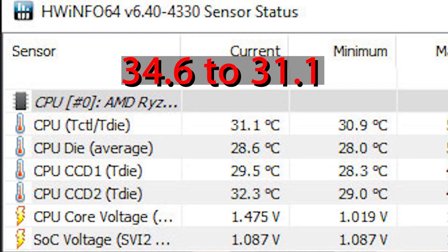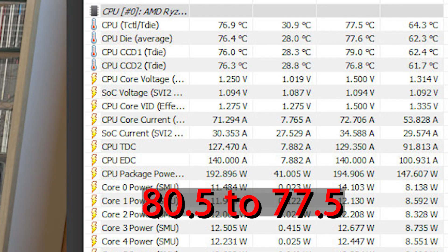So, surprising results even to me — we have roughly a three degree drop both at idle and max load, just by changing how the thermal paste was applied. I upped the amount a little bit and spread it out. If you've just done the P drop, I strongly suggest you reapply. And if you're doing a new build, I strongly suggest you apply it using the heavier spreading method for best performance, at least on your new Ryzen CPUs.